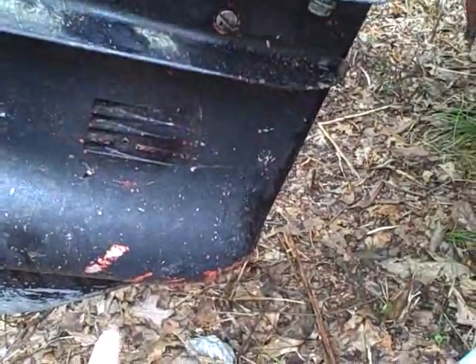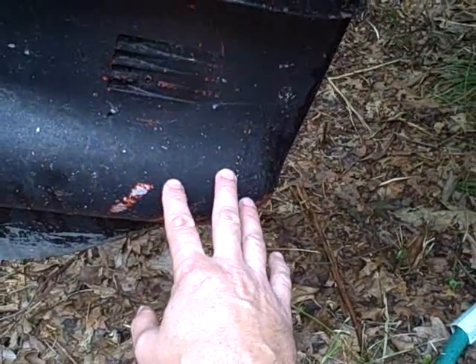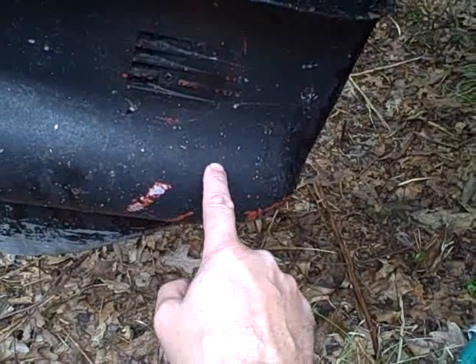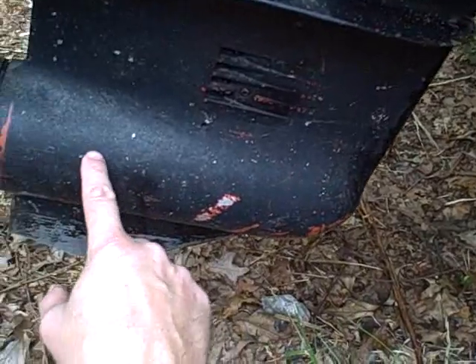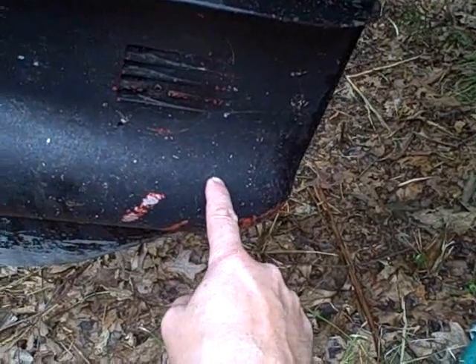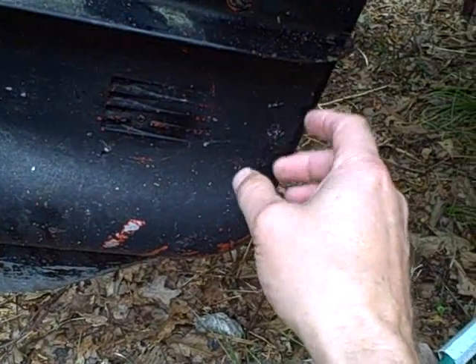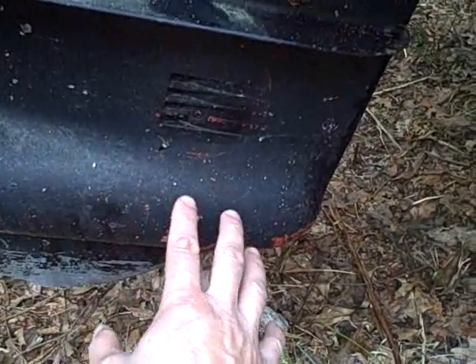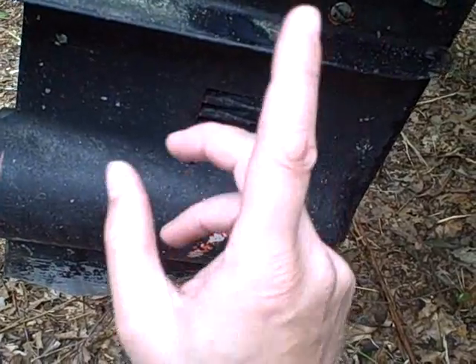It's 24 hours later and I know a lot more about how this works now. I did drain out all the oil overnight - I let it drip and there was a very slight amount of water contamination in the oil. More importantly, what I learned is that the way this system works, there's actually a pump inside here and it works on basically hydraulics. There is a servo in there, but the servo has to do with controlling the hydraulic flow. The default position for the system is actually in forward gear.